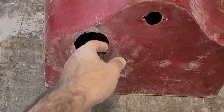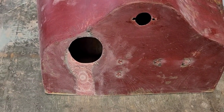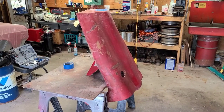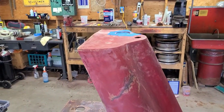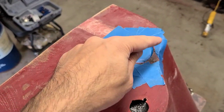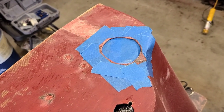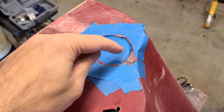So let me go ahead and set the hood up and get this hole in its final shape, and then we will tackle the outside. With the hood set up in a precarious position, I was able to get the back portion about as level as I possibly could. I did put some tape around the edge because I have a knack for spreading resin all over the place and I don't want that to happen. I just want to be able to fill the outer edge of the circle and fill in a few of these little divots.